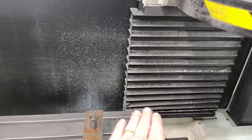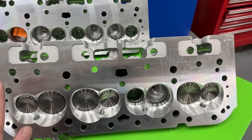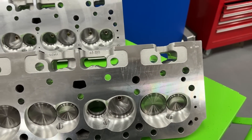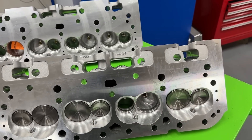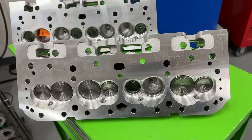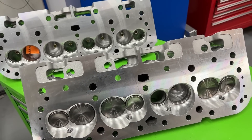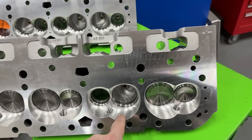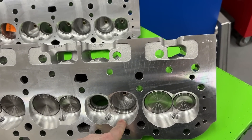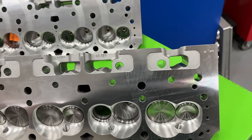The first thing you need to know is about milling. The way most heads are milled is called flat milling — you go over the mill, there's a cutter head up there, and essentially on a flat mill you just go flat across the head. The head sits perfectly parallel and the cutter head just goes across it. Typically if you cut off six thousandths you remove one cc of chamber size. So to get from 75 to 72cc they flat milled about 18 thousandths.